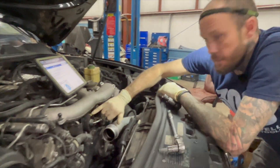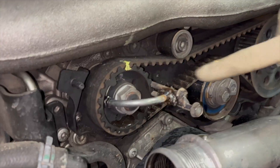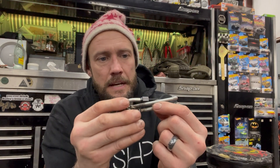So I went ahead and marked the fuel pump sprocket — the little mark right here. The important thing is I made this little homemade tool. This is the part where you're going to need to hopefully not have to make a tool, but you can go ahead and just buy the one that's in the link in the description. You'll see that you're going to slide it in and these two little legs here — the correct tool is a lot cleaner looking — but it slides into the end of the sprocket and then into two divots behind it that are going to help lock it in place. When you have this in and you have that 6mm Allen head in and you look underneath and you see that you have that divot on the bottom side of the block, you're A-OK — you're ready to get this thing done.